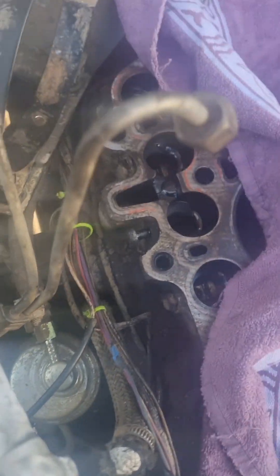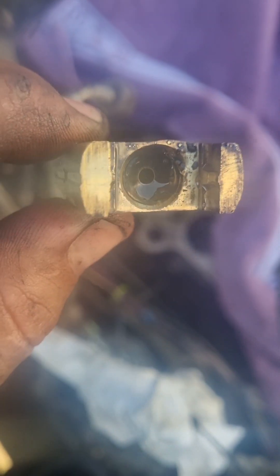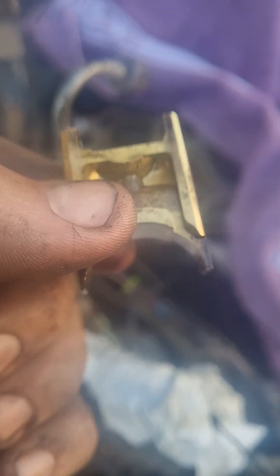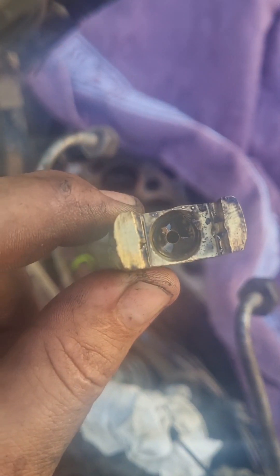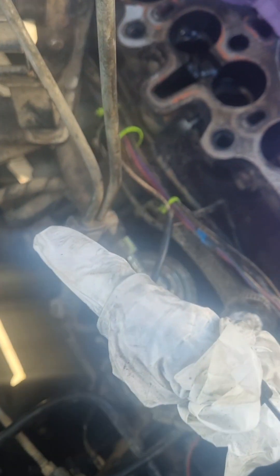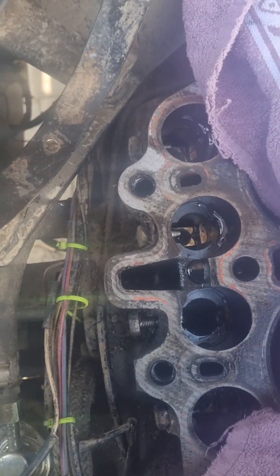In the process of checking each individual brass sleeve guide — the tooth-looking devices you can probably see at the very top of the screen. One is very slightly distorted. In order to change these you need the head off, hence why I took the head off — because I could just about see down the hole that the push rod looked suspicious. I've got two more to check and then I'll start ordering parts.